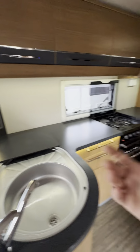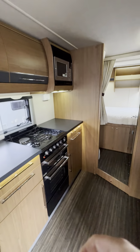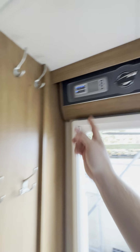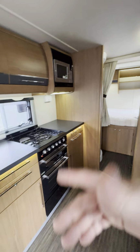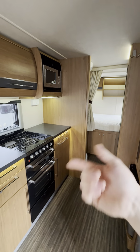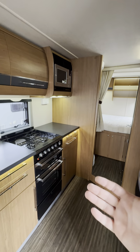If you turn the pump on and it just ran on and ran on, you would probably have either not enough water in the tank, which is why I said to check that you've got water in the tank, or you've got a leak somewhere, because if it can't quite get to that pressure because there's a leak somewhere, it won't turn itself off.